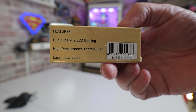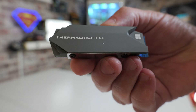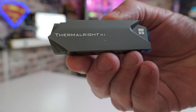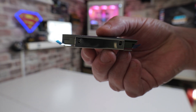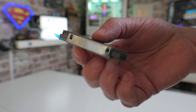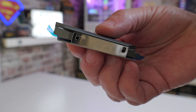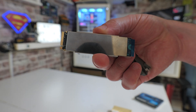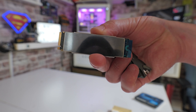So let's start off with the first one — the M.2 2280. This is actually one of the original releases from Thermalright for M.2 coolers. It's a nice little unit in a kind of mid-grey — not quite charcoal, not quite silver, somewhere in between. On the back there is an almost reflective base plate, with two screws either side. You've also got adjustability, so if you're using either a single-sided or a double-sided drive, you can accommodate both. There's a little bit of height adjustment on the side — loosen the screws and it opens and closes, which is great. Something important: the length of this is around 65 to 66 millimeters, and anything over 70 is generally going to be quite tricky to fit, so do bear that in mind.